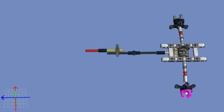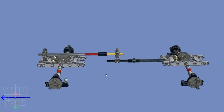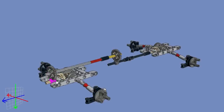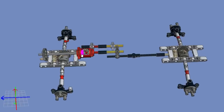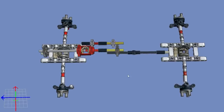Let's start with the front wheels. The front wheels drive these axles through the front differential, then the speed is significantly reduced through these gears. The next one is the rear axle — we see a similar differential and a similar gear reduction, but this time it is behind the axle. These two axles meet in the middle where you can see the central differential. The movement from the front and rear axles is joined here in the central differential.